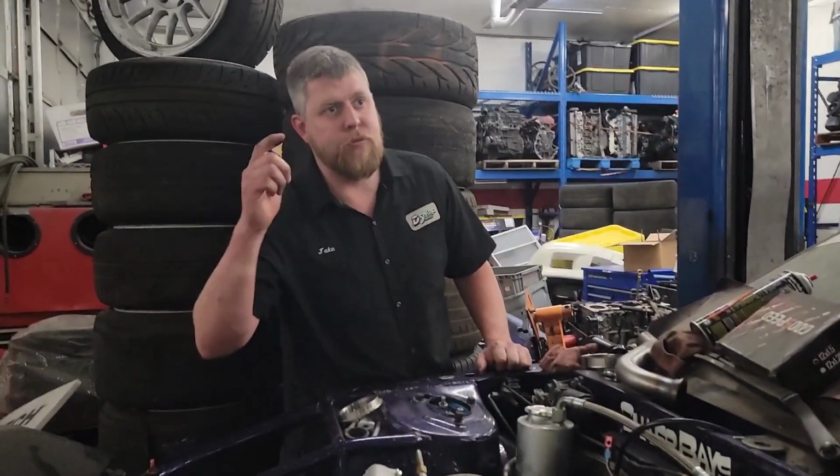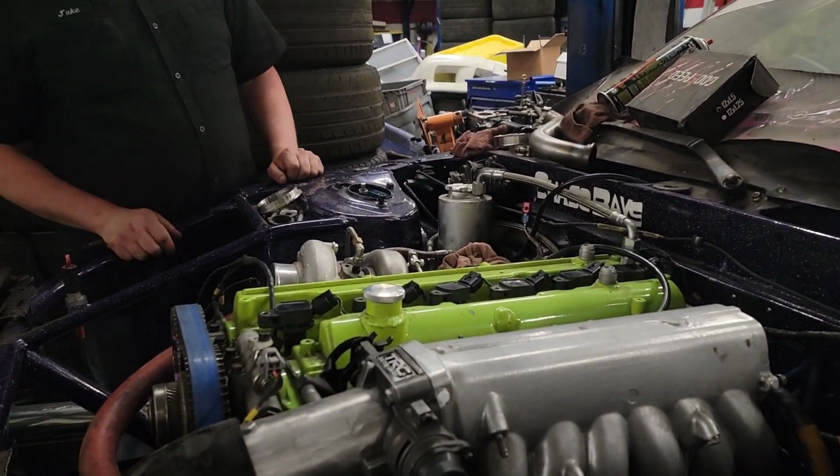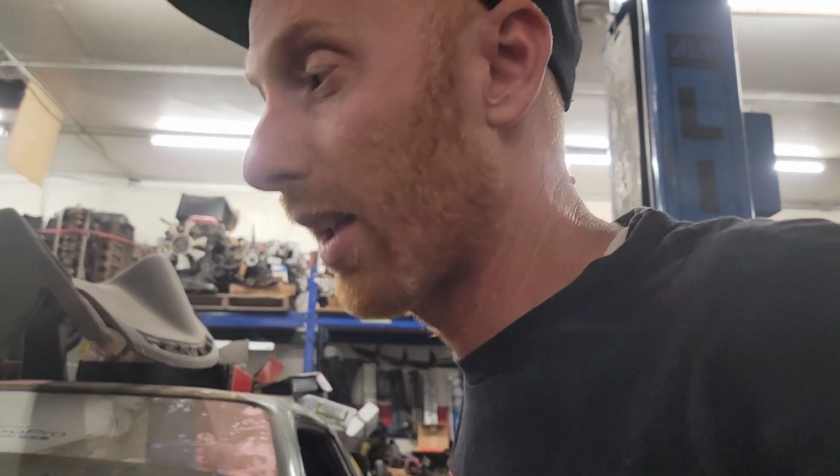I've had that turbo for like 6 or 8 years. I don't know if they sell it anymore. It never took off. It's a GTW3884. So it was between the 3582 and the 40 series, and it was a GTW, which had a larger shaft than the GTX series. It's supposed to be stronger. They said it maxes out at like 900 to 1,000 horsepower, so like 500 at 10 PSI. I can't really underrun this horsepower.